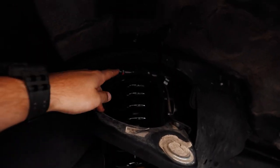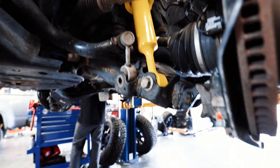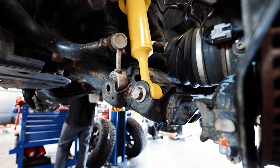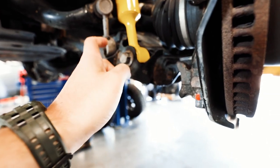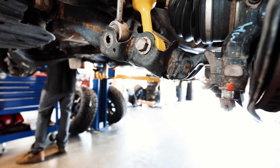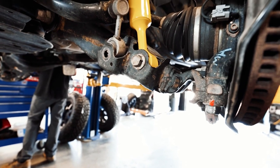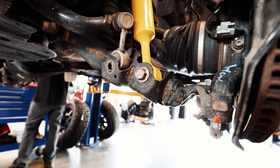This side is pretty much buttoned up. Quick tip: these sway bar bolts are easier to put in when the truck is on the ground. You can tighten and torque the lower knuckle bolts, but do not torque the lower shock unless it's a heim joint — wait until the truck is actually on the ground. Everything else is good to torque down, but the lower shock bolt will make the truck sit how it's supposed to, and then you can align it and torque everything down.